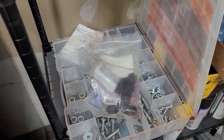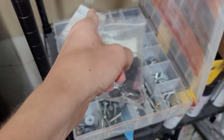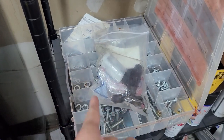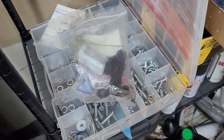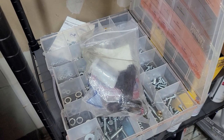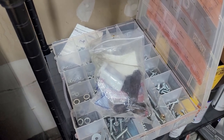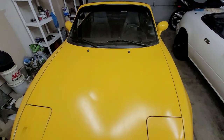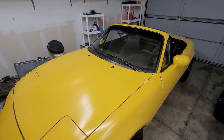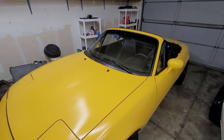So what I did: I walked the pushrod back just a little bit, then put in a new clutch master cylinder and bench bled it again — so this is like my fourth one of these in the past year or so. Bench bled it and it's been perfect since. Now you know. Thanks for watching. Bye.